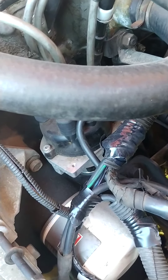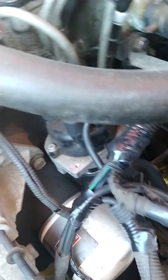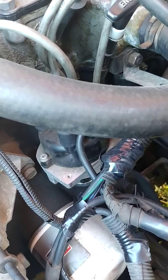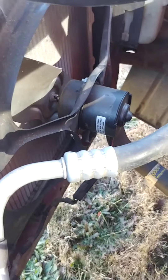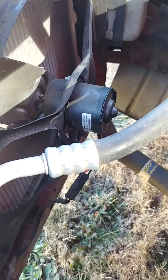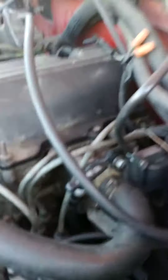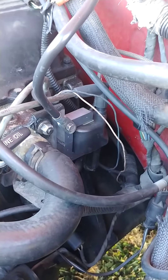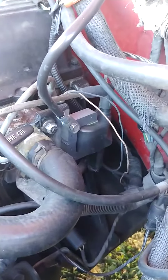I took it to an auto electrician and all kinds of stuff — went into three different shops and they weren't any help. I replaced the distributor and that other piece. Then I found working with the fuse panel that I had a bad electronic fan; when the fan would kick on, it would kill the truck. Somebody else suggested going after the coil, saying it would warm up and potentially fail, just like that timing piece.